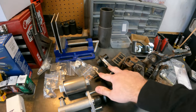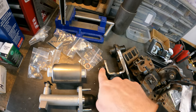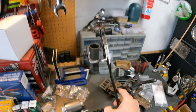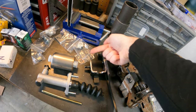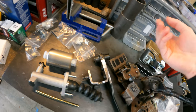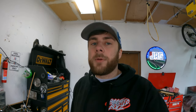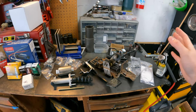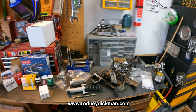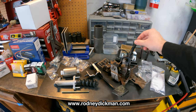I'm going to go ahead and start working on this. I think I'll start with the clutch pedal — just need to get a Dremel to remove some more paint, weld in the supports, add the new bushings, and then add the new pivot pin. This is ready to go back in — pretty easy on this car, just a long bolt that goes all the way through. Remove a nut on this side, pull the bolt out, and once you're ready to put it back together, slide the bolt through and tighten the nut. Pretty much everything here regarding replacement parts other than plug wires and spark plugs was purchased from Rodney Dickman — big Fiero guy with a whole website dedicated to this stuff and a lot of good information.